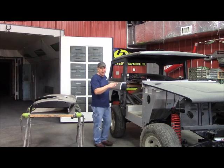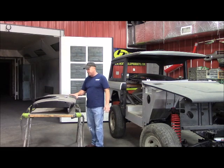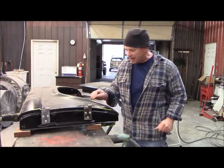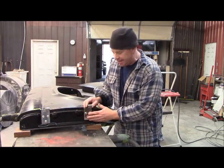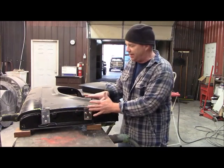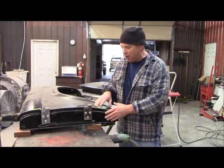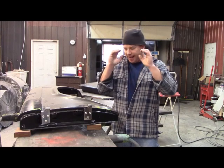Then I'll go and do the other side. When I get done with it, I think I can make all this sheet metal line up without doing any modification to the outer skin. I brought this back to my back shop so I can do some welding and cutting on it. The first thing I'm going to do is see what type of adjustment I've got in these hinges and then lock them down right in the middle of their adjustment. That way I can go up and down and wherever I need to go once I get it set.